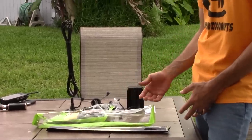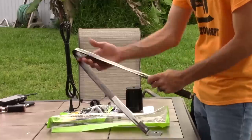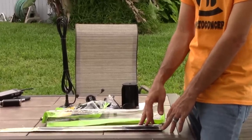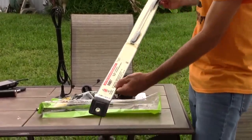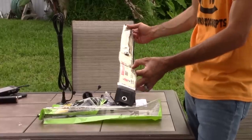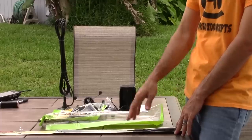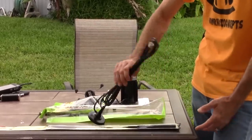If I wanted something with more gain or better range — because the more gain, the longer the antenna, the better the range — a lot of people are worried about talking to repeaters far away. To do that you'd want something like this: the SBB7, also a dual band antenna. This one is designed to be mounted on a fixed mount on the vehicle, whether it be a lip mount or a hard mount through your roof. The gain is 4.5 dBi on 2 meters and 7.2 dBi on 70 centimeters — it'll give you a little more distance, but it's just about 3.5 feet. What I'm worried about is whacking it on a tree when I'm driving on back roads. Low trees hitting something on a fixed mount can damage or bend the antenna, or a mag mount version might get whacked off by a branch — but no big deal.